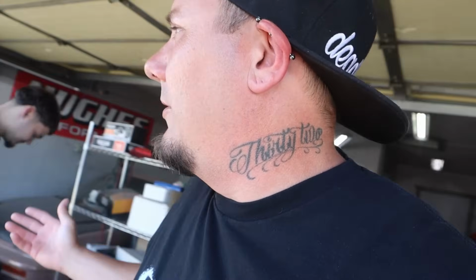So today's finally the day. Chawp is back. Well, fingers crossed, right? We haven't heard it run since it was on the trailer. Braven put the new oil pressure sensor in there, a 150 psi oil pressure sensor, to solve that problem. He ran all new AN lines for the areas that he was having problems, and he used PTFE so that he is capable of running E85 in this thing, because he found out it does have a factory flex fuel sensor. I don't think the tune that's on this thing is tuned for E85, but at least he has it there for the future. All the AN line that he added is E85 safe, as well as the factory line should already be, right? Right, yeah.